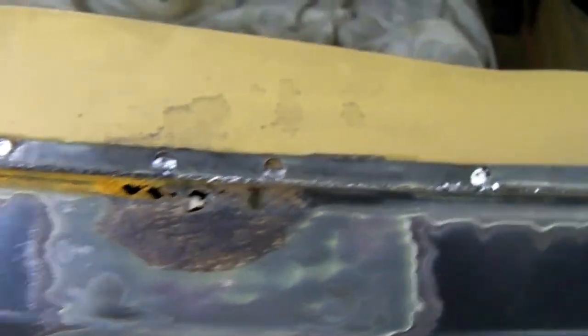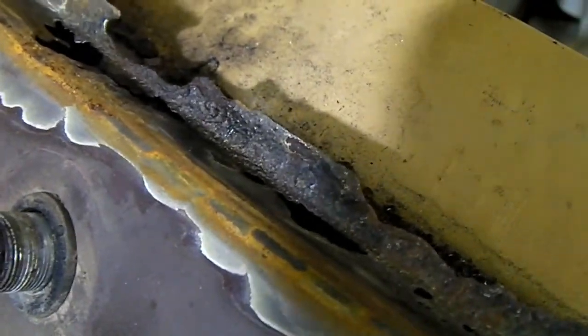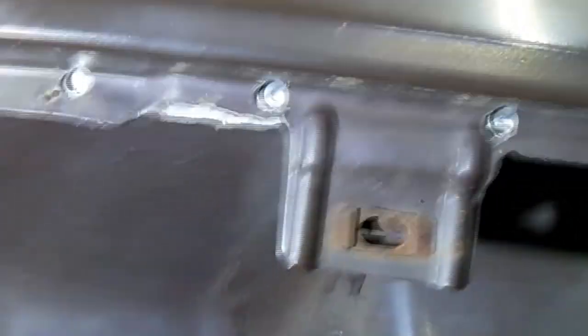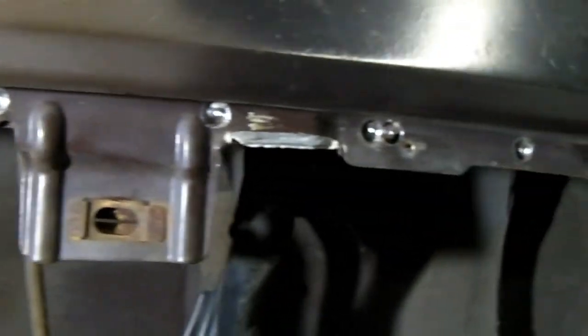Okay, that's all of them done, all on the top. Sorry, I've got to go slower - my daughter said I go too fast when travelling along stuff. Already done along there as far as I can go. I've got a cut down there because I can't find the spot weld in the rust. And in under, all the way along in that position there. There's sealer in between just holding it. And behind, that big lump - there's a big wadge of sealer as well. So you've got to scrape that out before it frees off. All done, all along. And now I'm just going to cut down this side just inside the seam, and this side just inside the seam.